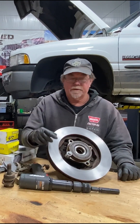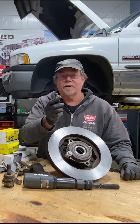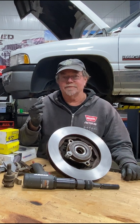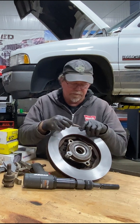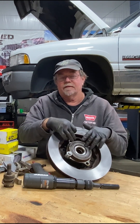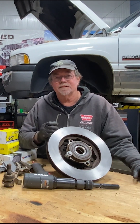That's your Tech Tip Tuesday. Use an air chisel on the flange bolts, and make sure you use the socket — trust me, you'll mess up the head on one of those bolts and have to buy new ones. Second tip: sacrifice a 5/16 Allen wrench to get the ABS speed sensing unit off the hub assembly. See you next time.